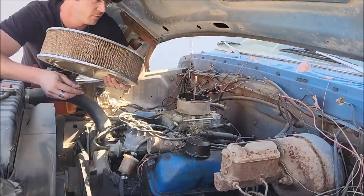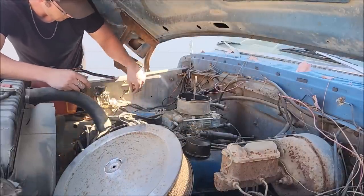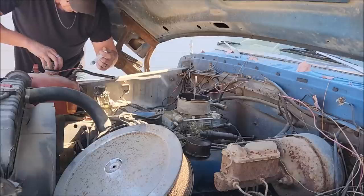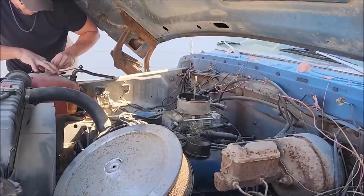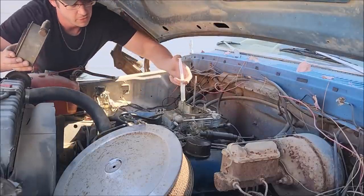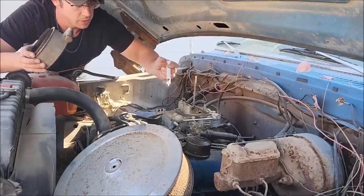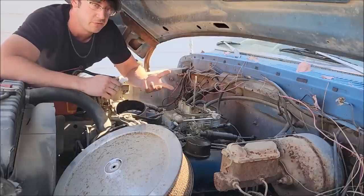And the best way to do that, since definitely our carburetor is entirely dry at this point, is it kind of works out where my wife is a veterinarian, so we have these syringes laying all over the place. You can simply just fill the float bowl, like so, right in through the vent. We're gonna do this till it's good and full, and that way we have fuel immediately when we crank, and it has the best chance to fire right off.